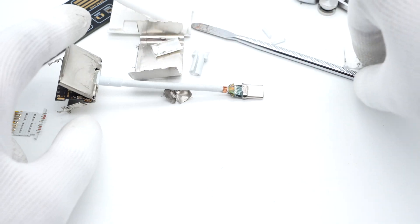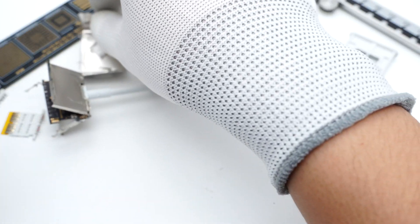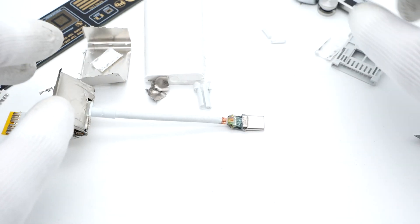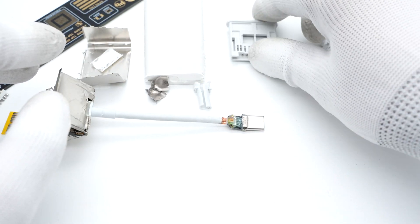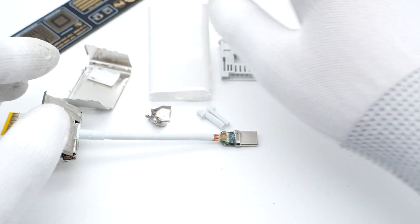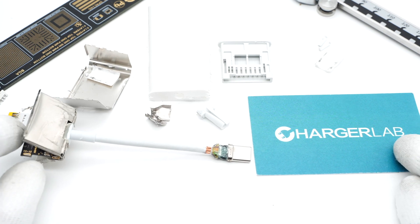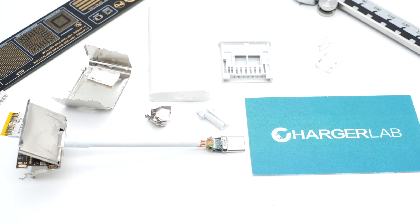That's all the components within this USB-C to SD card reader. After taking it apart, we found it consists of three parts: PCB, card slot, and USB-C connector. It adopts three steel shields and a huge amount of glue for better insulation and durability. The temperature sensor can detect the internal temperature to prevent overheating. Okay, that's all for today's video. Feel free to click the corners to check out other Apple-related products. Please drop a like, leave your comments, and subscribe to us. I'll catch you guys in the next video. Bye.